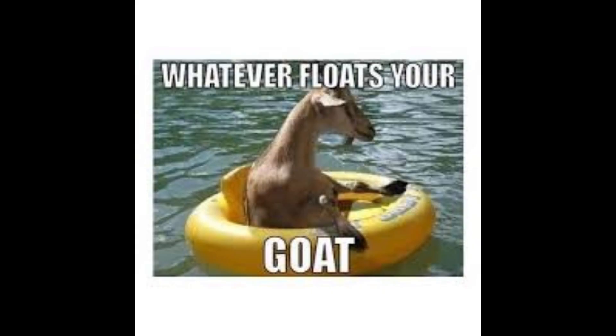I don't have footage of it, but what actually caused this was the head had K-liners in it. If you look at another one of my shorts called 'I Hate K-liners' — this is the second case I've had in a while, and I see it all the time. But this time K-liners actually caused this engine to fail, because the valve guide wore out so much that the valve went to the side, snapped, tumbled around, and blew up everything in there. I hate K-liners — that's all there is to it. Enjoy this picture of a goat. Thanks for watching, please subscribe, see you next time.